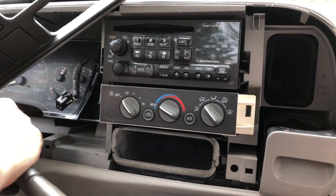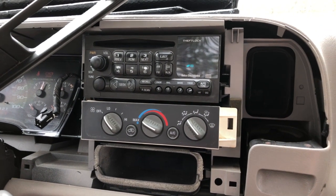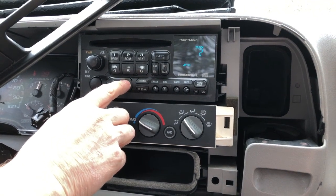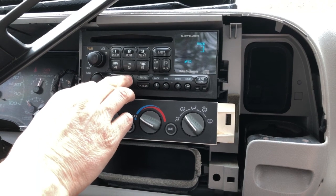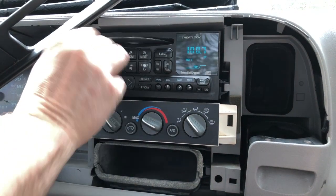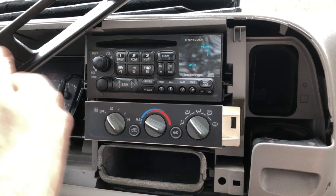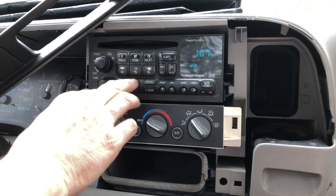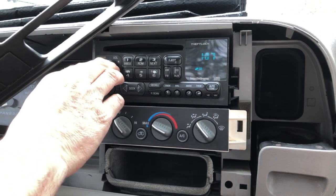We've got the radio put back into the vehicle. Turn the key to the run position, pop the CD in — and this time it works. We're able to cruise around any of the tracks with no problem whatsoever. So if you get this error on these old radios, it's a combination of dust and debris on the laser as well as on the gears. Do the procedure I showed you and you should be good to go. If you found this useful, please like and subscribe, drop questions in the comments, and thanks for watching.